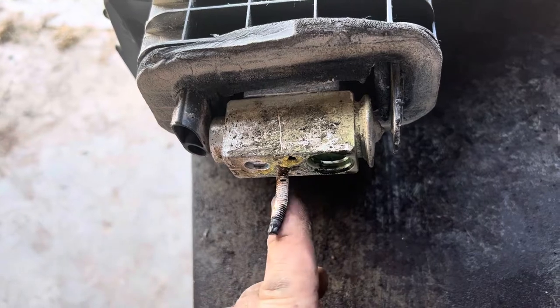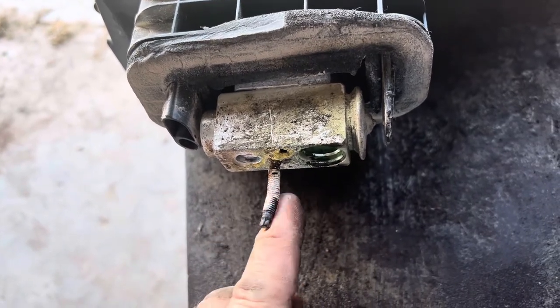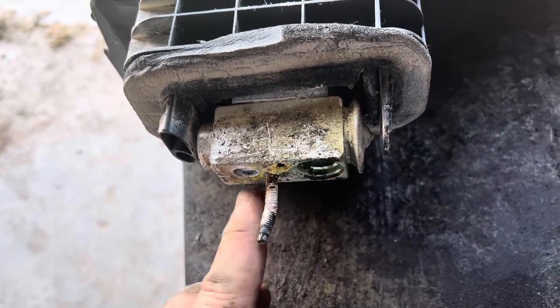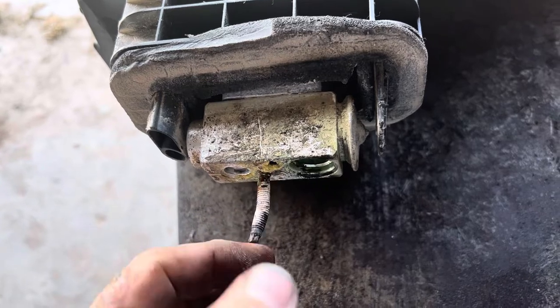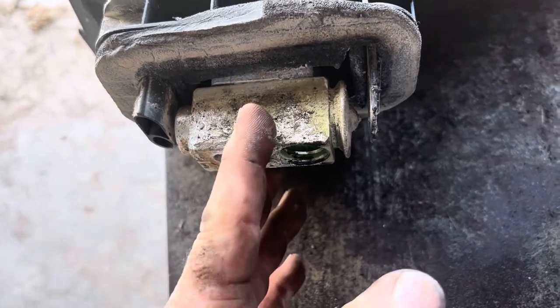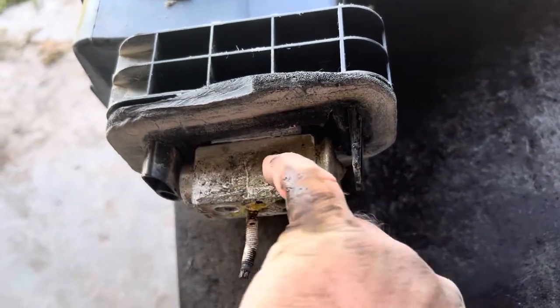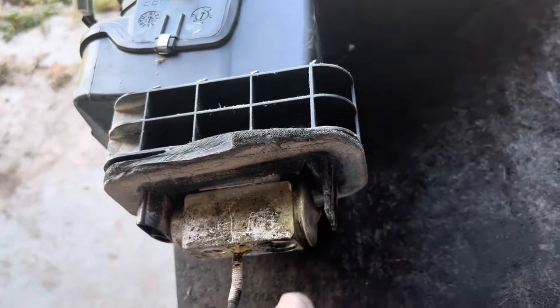What I did on this one, this hole is pretty big down there in that plate. So I took my straight pick and just kept going around it, scratching on that corrosion, and of course it powders, and I ground my way 3/4 of the way up, and then I had a wrench that would fit on it just perfectly. While my boss wiggled on the top, I wiggled, and then I put a crowbar up in there, and I was able to hook the top plate and pry against the body, and I put some down pressure on it while wiggling, and it started moving, and then I started seeing all that powder start to fall out of the hole.